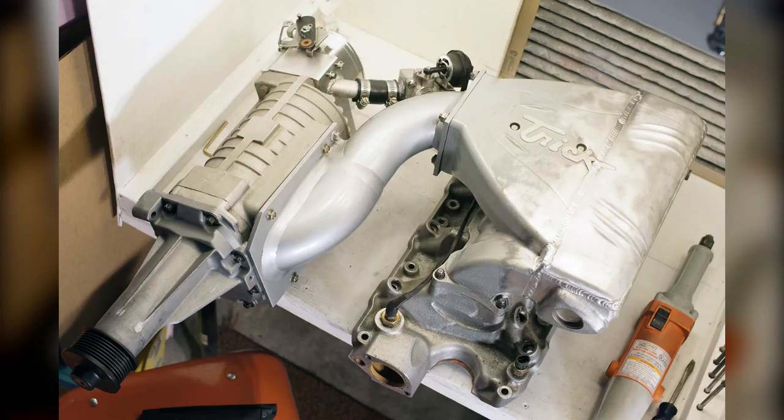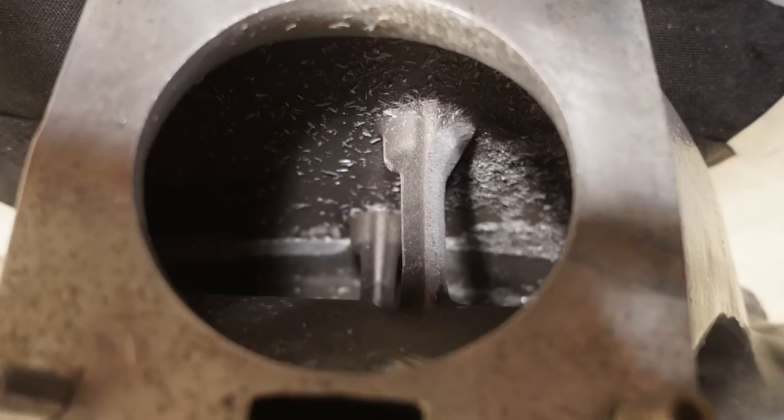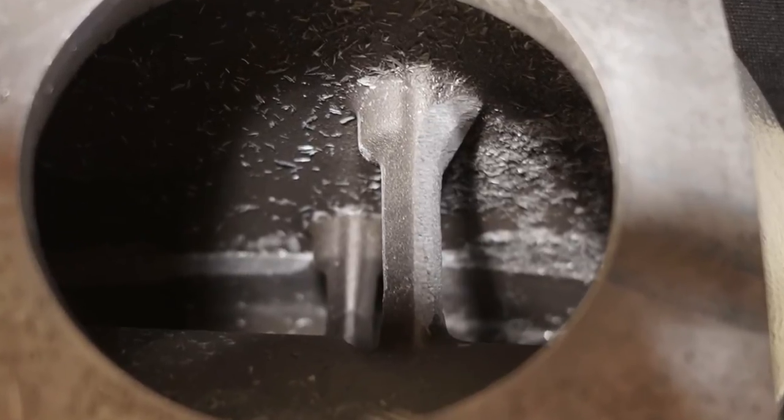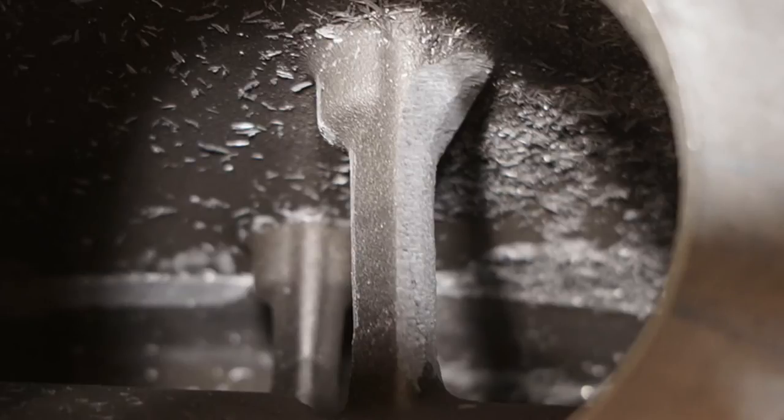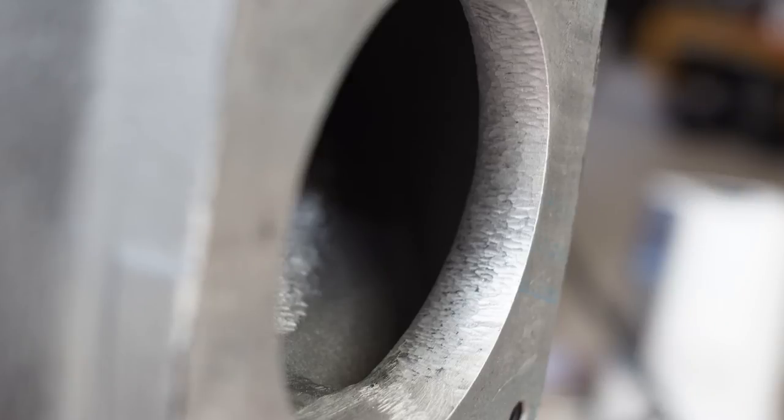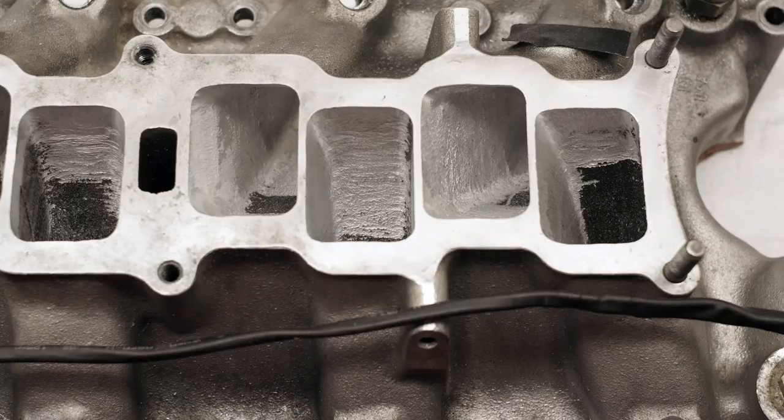So I turned to the upper intake manifold. Not surprisingly, the front cylinders were lowest in flow — but somewhat surprisingly, the frontmost cylinder was actually flowing quite well. It was the two behind it, numbers 2 and 5, that were the worst. Looking into the upper manifold, I noticed that one of the two bolt bosses, the one closest to the inlet, was lined up directly with cylinders 2 and 5. So I cut down the side that was blocking the flow more, and also did a chatter cut on the radius on the opening of the upper intake manifold — but on the front side only — to create a boundary layer and help air stick to the radius more, hopefully moving more air to the front. I also did a little more work to the lower runners 2 and 5, but the lower was already ported to death, so there wasn't much left to do there.